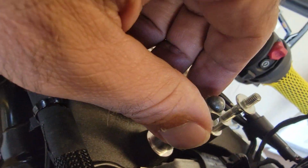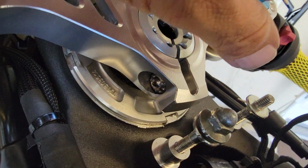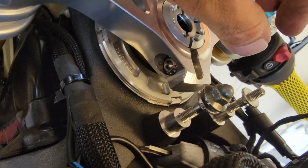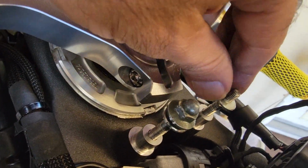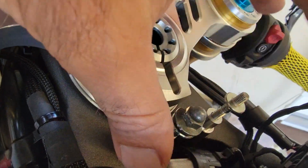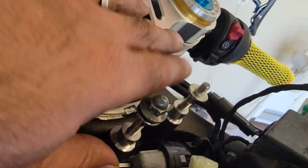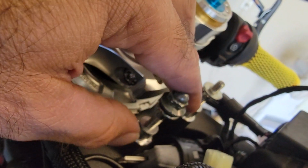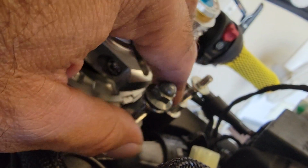This is where the kill switch button goes. The original key unit goes out, which is hella heavy, and I don't want to have a key peeking out, crashing on it, it breaks off and all that stuff. So I've been there. Ask me how I know. So this is where that unit goes, and the next problem here is there's usually a plastic cover. This will be replaced with carbon, and when the kill switch button is in, it has a certain height, so that just peeks out of this plastic or carbon just as much. So that piece of carbon has to be prepared to allow the bigger head of this button.